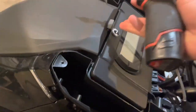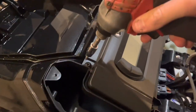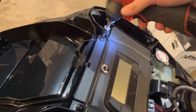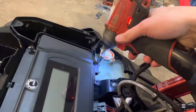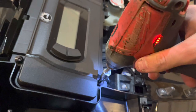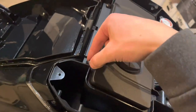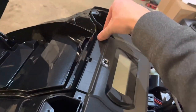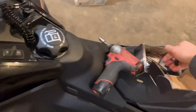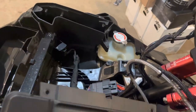It's actually not a hard process. Open this up — there are four bolts for your gauge. Take those out, and make sure you don't drop them because they'd be hard to find. Your screen just kind of comes out like that — I still left it in place.